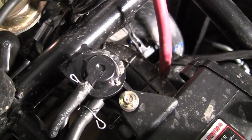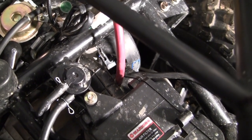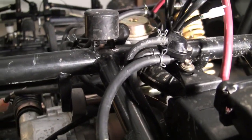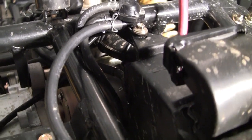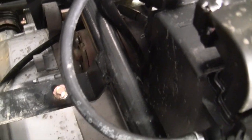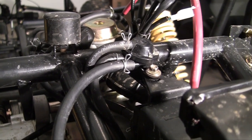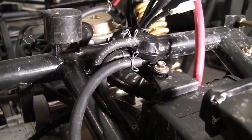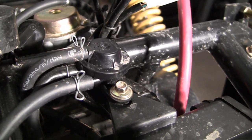For your complete fuel system you need more hoses than just a hose connecting the gas tank to the engine, because your engine isn't 100% perfect. Often gasoline fumes and harmful vapors leak in various places. For example, harmful gas vapor may be leaking from the fuel tank, the carburetor, or some fuel vapors may get past the piston. In order to prevent these vapors from escaping into the atmosphere — which would be bad for the atmosphere — and to prevent wasting fuel, they designed a PCV system.